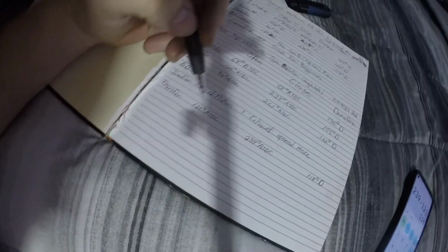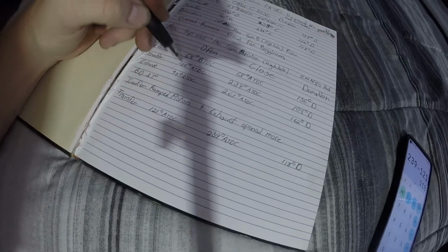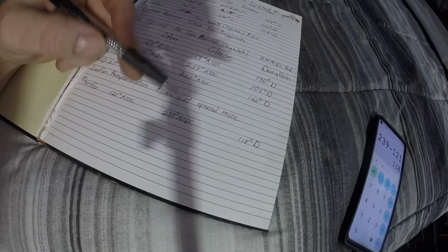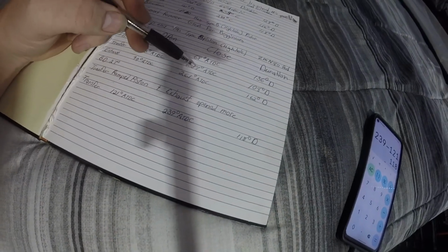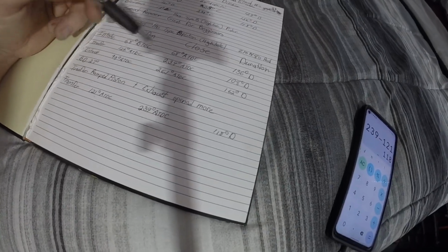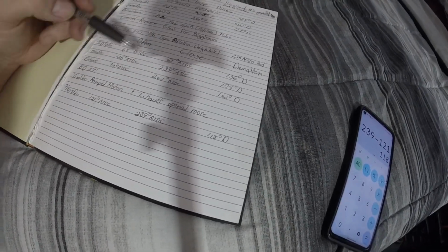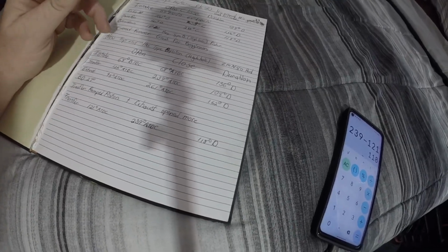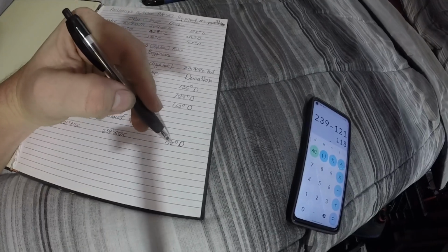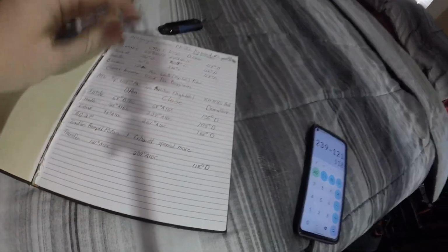So anyway, I put this in my new numbers. Transfer opens at 121. Remember, it was opening at 126. It now closes at 239. It did close at 234. So we have a difference of 5 degrees, which is actually 1 degree more, 2 degrees total duration than I was expecting to get or hoping to get with a mild thing. We went to a transfer of 118 duration. That is freaking awesome. That's pretty much balls accurate for where I want to be.